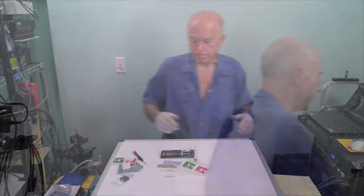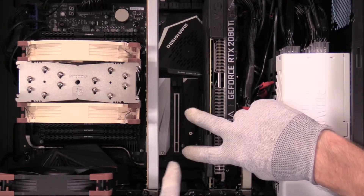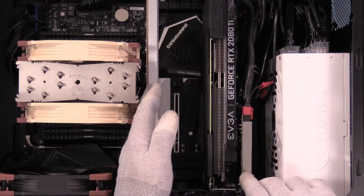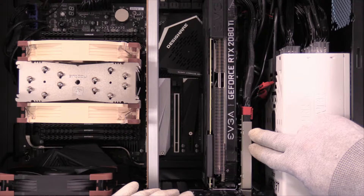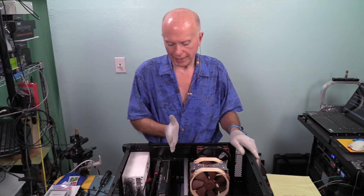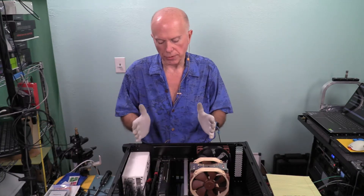We'll cover the why, what, and how in the summation. We'll also try a different pad because there are issues with pads we need to address. Now let's get this in the test system. We're working with the Gigabyte TRX40 Designare, which has two 16-lane slots and two 8-lane slots. We're going to be in the primary 8-lane slot, bifurcated in the BIOS to allow four lanes for each of the two drives. In the second 16-lane slot we have an EVGA GeForce RTX 2080 Ti, two slots wide. In the primary 16-lane slot we have the Gigabyte Aorus M.2x16 quad card. In the second 8-lane slot we have the Gigabyte Titan Ridge Thunderbolt 3 card, which only requires four lanes — so we lose those other four lanes, as there's no way to reallocate that. A slot and lane assignment is specific — dedicated resources.